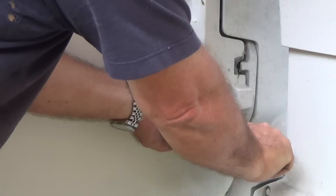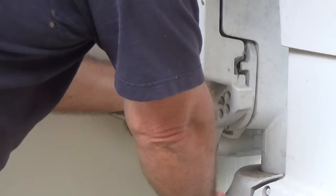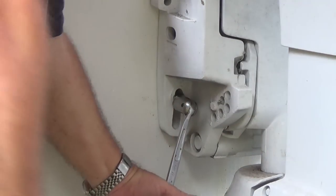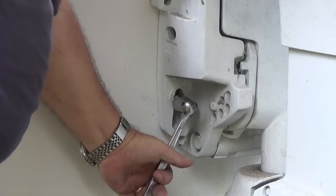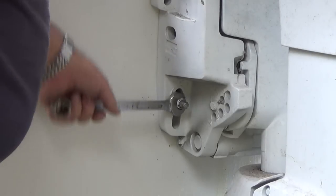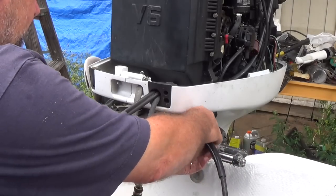And when I do, I'm gonna get some sealer for here up at the marina. Cause I gotta buy the, for the hydraulic steering, I gotta get that oil and we're gonna have to bleed that system out and all that, so we'll do it. Just gonna snug them up here. Those O-rings look okay in there, so I'm gonna leave it at that for now.